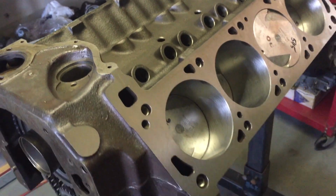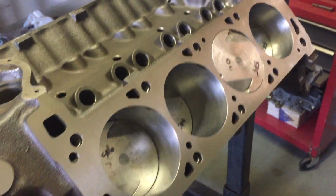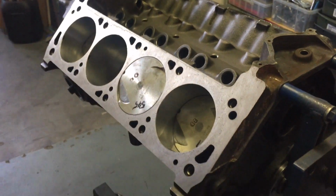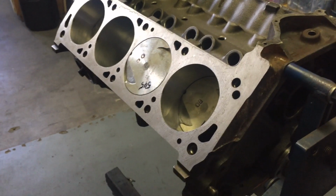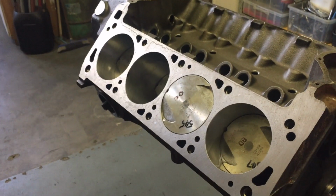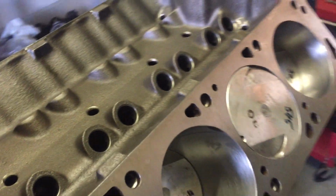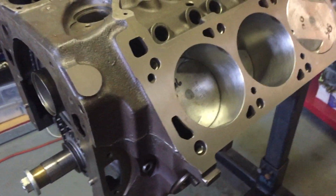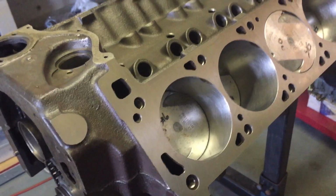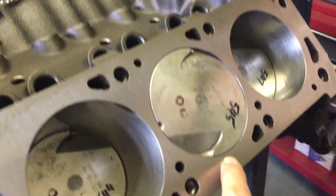So what Ford Australia did is when they got their standard 4V short motor, they pulled it apart and they proceeded to machine the deck because they wanted more compression. The fuel at the time was what they called super, which had possibly in excess of 100 octane, and it was leaded, and so it was not really prone to detonation as easily as our fuels are today. So in their infinite wisdom, Ford Australia pulled the short motors apart and proceeded to surface the deck of the block approximately 25 to 30 thou, which gave them pretty much a zero deck height.